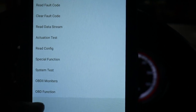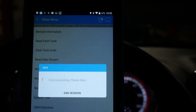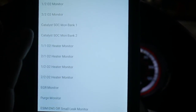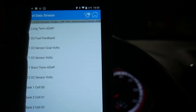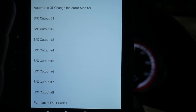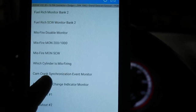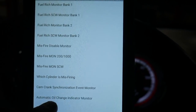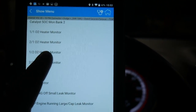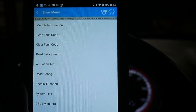We're able to see our configurations and the OBD2 monitors. In the Dodges especially, we're able to see which cylinder is misfiring, cylinder contribution style tests, heater monitors, O2 sensors, the different banks and data streams for those specific OBD2s, cruise control cutout. You're able to see what percentage you're at for the oil change indicator monitor, which cylinder is misfiring — all the normal things that us as technicians use on a daily basis. It's all there and it's all inclusive.